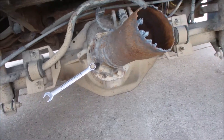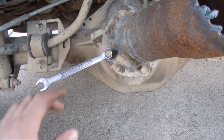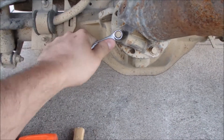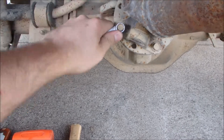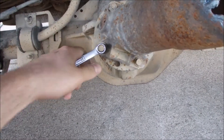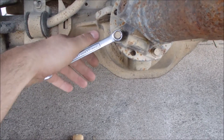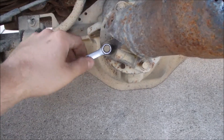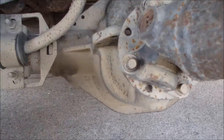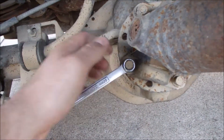You're going to want to put the vehicle in park, if it actually has a drive shaft and isn't a trailer. Put it in park, put the parking brake on, because you don't want it to move. You want to limit that as much as possible. I'm going to remove this one, so I'm going to bring it down, take up all that slack and bring it down. Because if you're hitting it like this, part of your energy is going to actually turning this until it gets somewhere where you're applying torque to that bolt. That is a 12-point wrench, right on there.